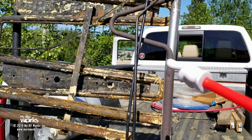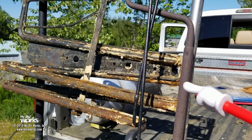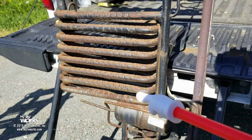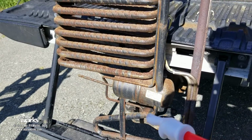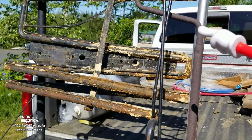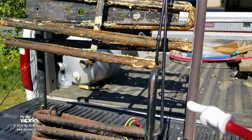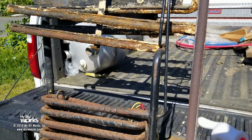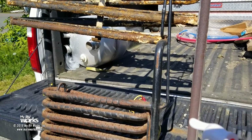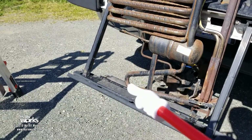Well, the water's going to fall back down. Remember that transition that's about right there? So the water's going to fall out. Now we're going to be on the outer tube. We picked up our ammonia and our water here on that inner tube, but as it boils out here, the water's going to fall back down and go on the outer tube. So the outer tube has got some super hot water. It's going to help create this heat exchanger here to help that ammonia and that water work even more efficiently, okay? And that water is going to fall all the way back down here, all the way down here, all the way down here.